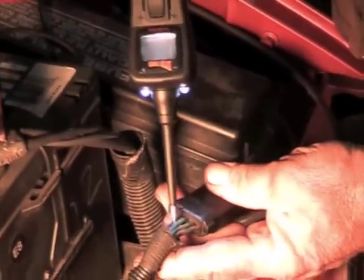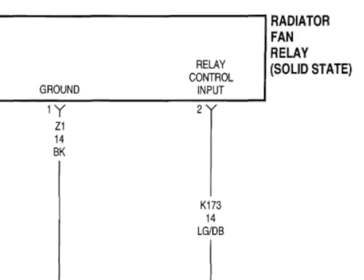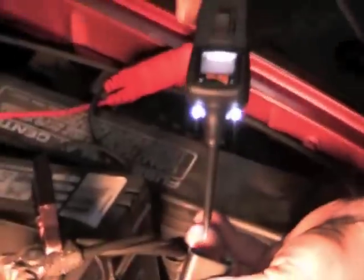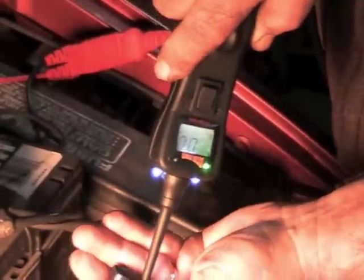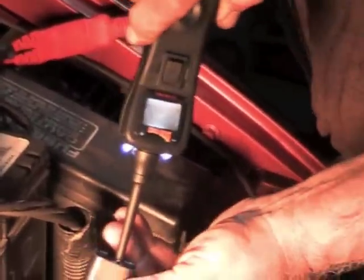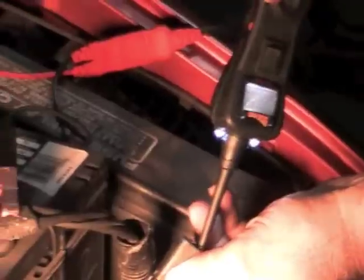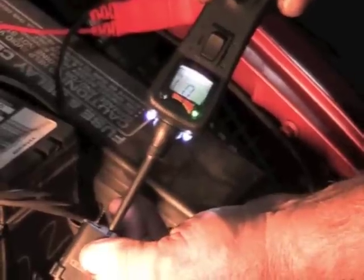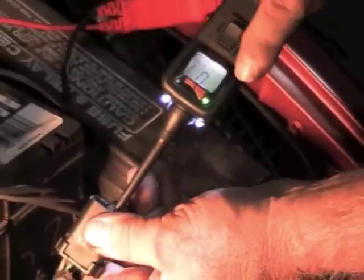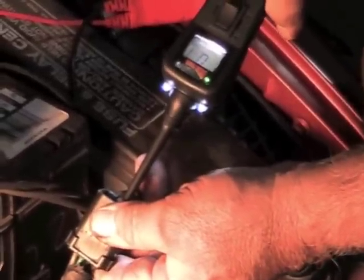Look at your wire diagram. The black is the ground. The small or light green wire is the command side from the computer. The gray has power and the black has ground. Now we're going to go to the smaller green wire — and you can see there's nothing on that. We turn on the AC compressor and see if the computer is going to command this on. Now we're on the command side wire, and it tells us that the computer is commanding this on. You'll see that the ground is flashing because the computer does not just give it a solid ground — it gives it either 30% or 100% control.